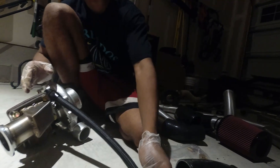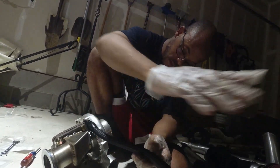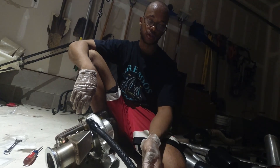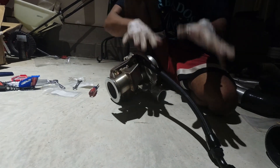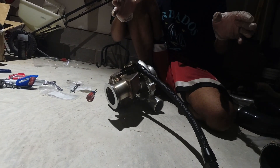If the drain isn't facing fully down, undo it slightly and swivel it until it faces the right direction. This oil return line goes right down to the sump that was drilled and tapped at the beginning — straight into the sump. The turbo is now clocked, the oil return line is on, and everything is set. It's ready to go into the car on the hot side.